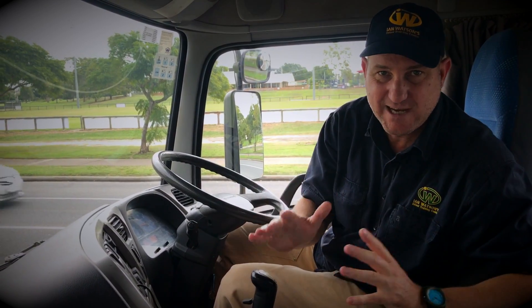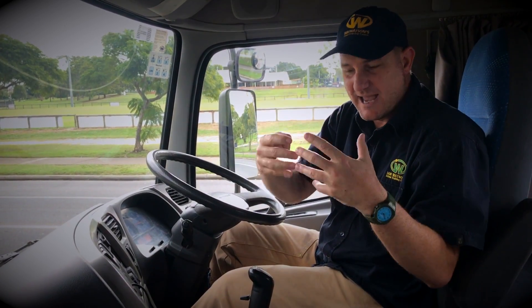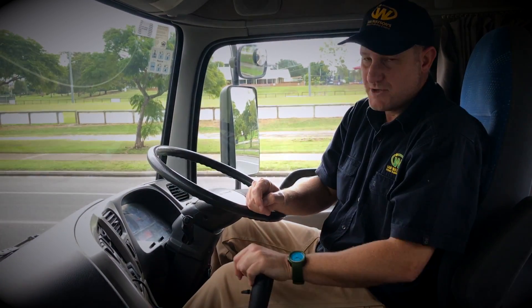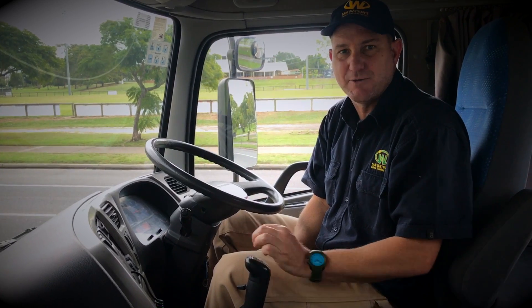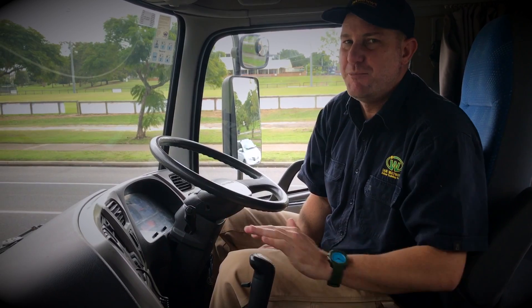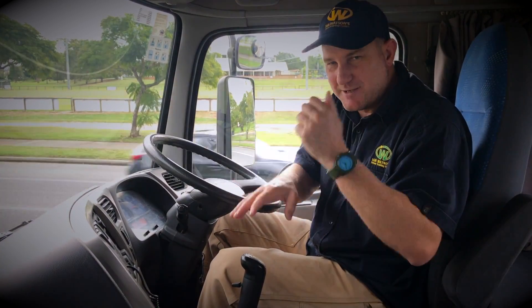One of the main secrets when you're stationary and trying to find a gear: don't rush, just take your time, don't force it. It will go in if you've got the clutch brake engaged and then released, and you just ease the clutch out — it should just find a gear. When you hop into a new truck, before you go driving, I recommend you find where each gear is located while stationary. You get familiar with the pattern, the clutch brake, where it engages, and you also start to get familiar with the friction point.